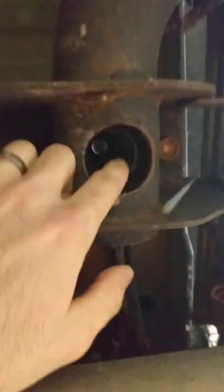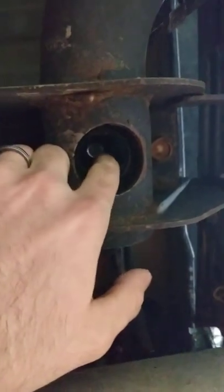When you're rolling around from underneath, you're going to want to look basically where the cab and the bed come together. Your first one is going to be here — this is going to be the easiest accessible one. You're going to want extensions for these because a normal socket will not reach. The one in the middle will be right here dead center where your spare tire is, up in that hole. Your third one, the furthest one back where your hitch comes in, is straight up in there. Remove those six bolts — the other side is exactly the same.